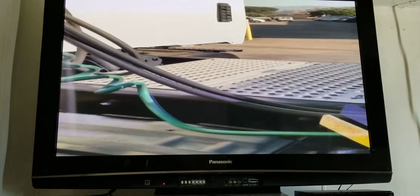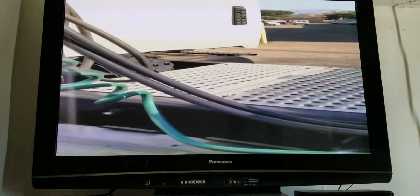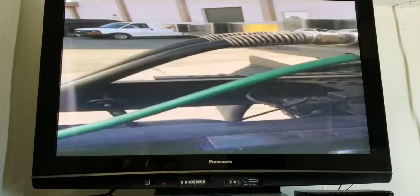I have my three lines. I have my electrical line, I have my emergency line, and I have my service line. They're all properly mounted with no loose or missing bolts and connected to the tractor. And my hoses have no cuts, no leaks. They're not dangled, torn, frayed, and they're not dragging around the exhaust system. And they're properly connected to the glad hands with no leaks.